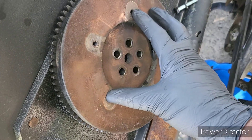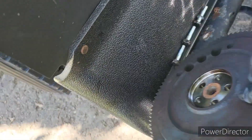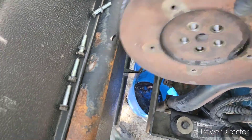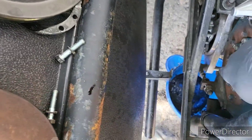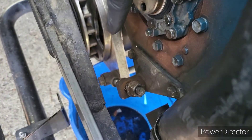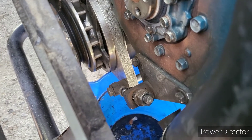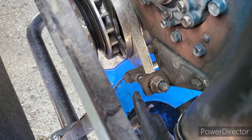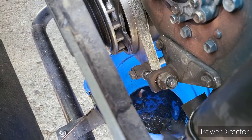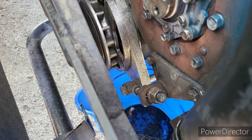The next step is to put the flywheel back on. After the flywheel goes back on, it sits this side in there like so, and then we'll put that pulley and belt back on. For the generator, there's an adjusting bolt and sleeve that helps you adjust the belt. You'll need to loosen the bottom nut, pull the generator up towards you and remove the belt — and the same process to put it back on.